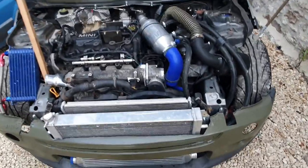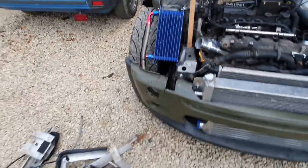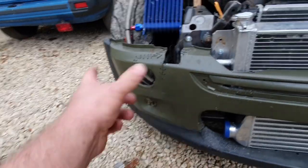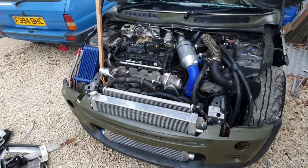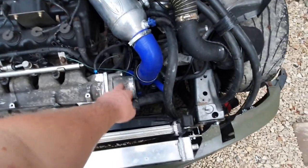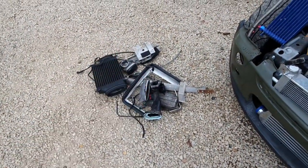Maybe next Saturday we'll try to plumb in some of these bits and pieces. We're going to make more brackets coming off this main front panel to locate everything. We've got a charge pump to go on that side and some air ducts to go off to the brakes, and we're going to mount these in the steelwork behind so we can just move the bumper on and off. We need to trim some bits here to get the boost pipework in. The throttle body has been reset, the car runs and drives okay — see you next week.